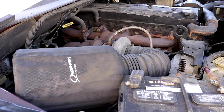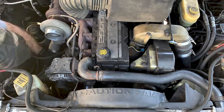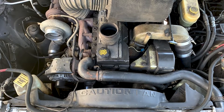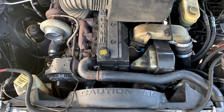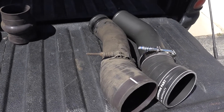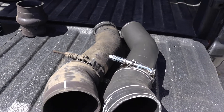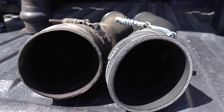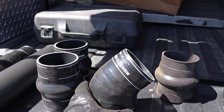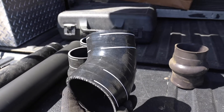In order to get these old pipes and boots out, all you have to do on the passenger side is remove the air intake — I have the stock air intake right now. Remove the air intake and you should be able to get at the clamps to get the boots off and pull the pipes out. Here's the stock passenger side intercooler pipe coming off the turbo to the intercooler. The pipes are about the same size, but the boots are much thicker with more layers. One more thing to note: the boot with the sharper, more acute angle is going to go on the driver's side.